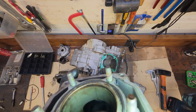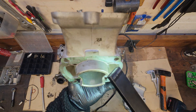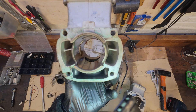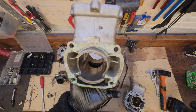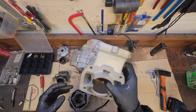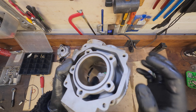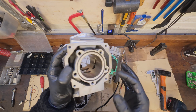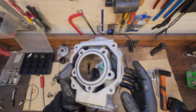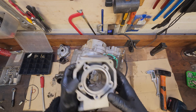I'm not really confident we can use this cylinder anymore, which is a bummer. Because that scratch — it's not just a scratch, it's actually the coating that has worn off. I'm not sure if we can save it or if it needs to get replated, because if it needs replating I might as well just get another one. The Mitaka has some minor scratches but this can be honed without any issues, so maybe we even have a better cylinder here.